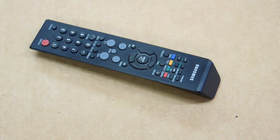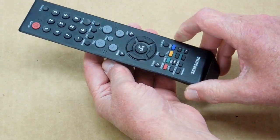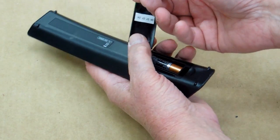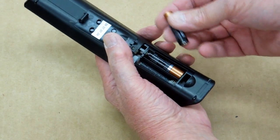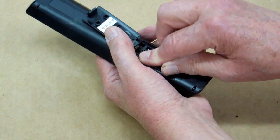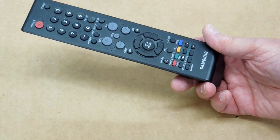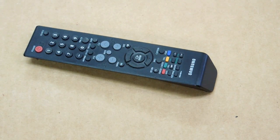I have the calendar on my computer set up to remind me to check batteries every three months, and that's not often enough for things like remote controls. So about once a month, go in, pull the battery out, look at it, make sure there's no indication of wetness or corrosion, and look at the contact points. A leaking battery can rot that spring out in a couple of days to a week. If it gets on the circuit board, it can ruin the circuit board very quickly. So check those at least once a month. Just because the device is still working your TV, that's no indication that those batteries aren't leaking — I've had flashlights operating at full brightness that had leaking batteries in them.